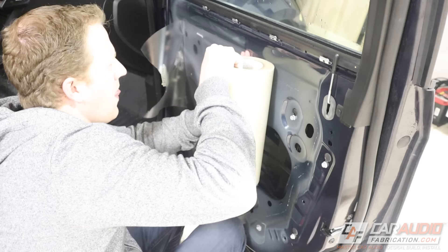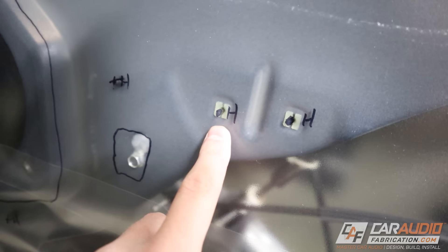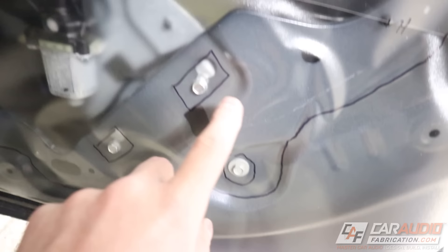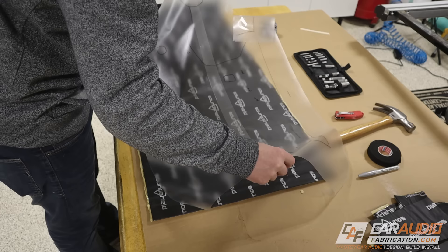For this part of the door, I start by applying some special tape that allows me to capture a template — I'll put a link to this tape in the video description. I've drawn out each of the different hole locations where I need to use my punch, and for areas that are a little bigger than the punch for access to bolts and things like that, I've marked a larger circle or rectangle that I need to cut. See these holes around the outside? These are where the fasteners from the door panel go to hold it in place — I don't want to mess with that fitment, so all of my material is going to sit completely inside of this edge. Now I can carefully remove my tape template from the door, put it on a piece of material, and start making my cuts.